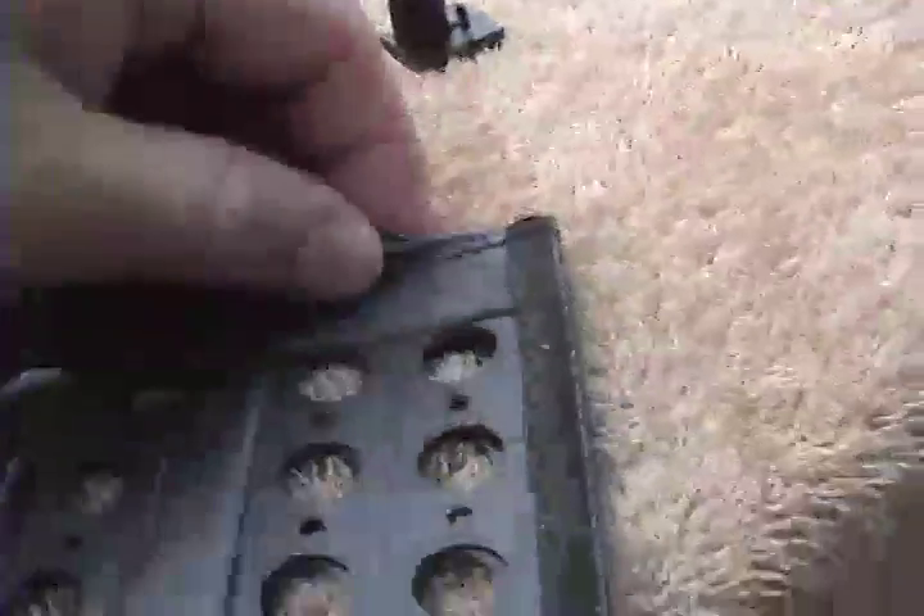We've got all of our plungers and springs sitting out in the sun drying. So we're going to reassemble this mess. The foam mat goes down first — make sure to line everything up properly. Before you proceed to final assembly, you must insert the leveling bar into the spacebar by installing the spacebar first, as shown. Once you have finished inserting all of the plunger assemblies, the keyboard must remain upside down. Ensuring that all surfaces are dry, clean, and free of any dust, you can place the metal backer plate on top of the steel punched plate assembly.